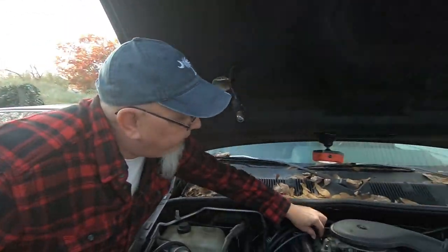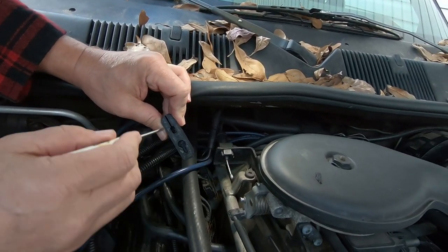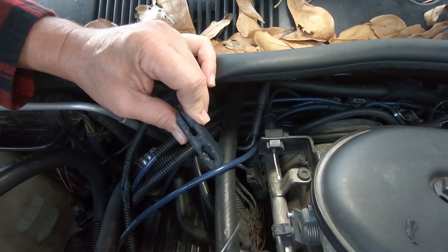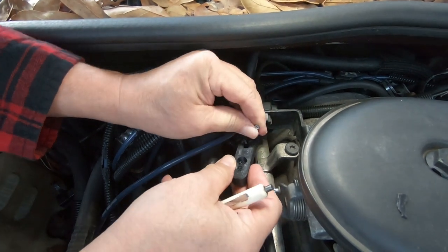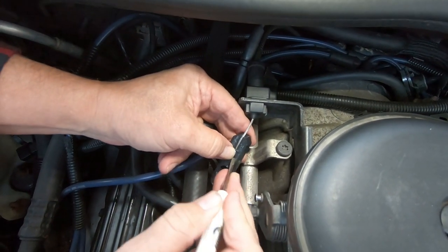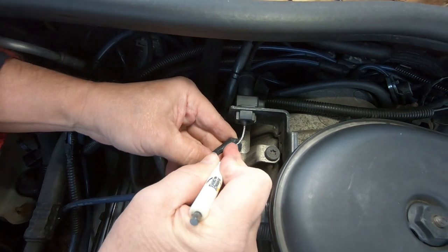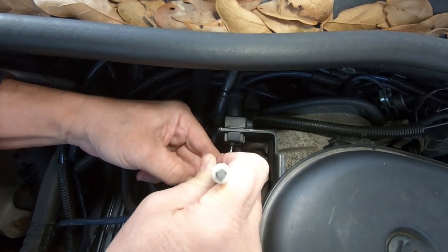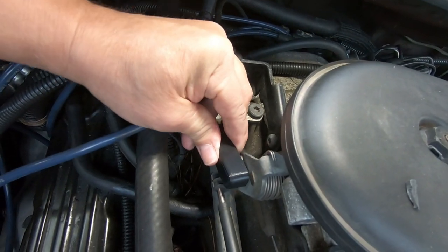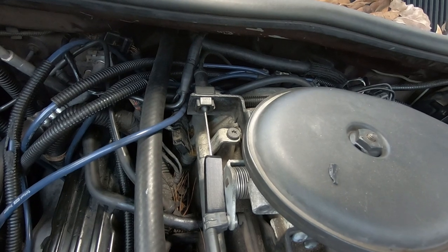What we've got to do is slip this cable. I believe this is called a ferrule on the end. There's a recess in the part — we've got to put that ferrule in here. Cable slips through there. This actually slips onto the throttle arm. Pretty ingenious little design. Let's get that popped in there. It's a tight fit, which is good because you don't want this thing slipping out. Now it's not going to come out. This part slips into the groove and it snaps right in place. Now it works like it should.